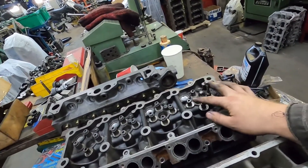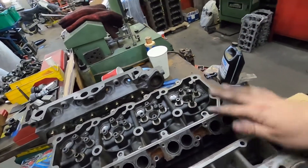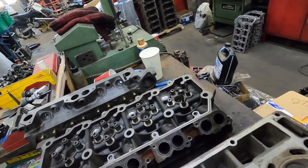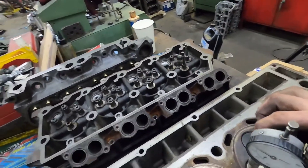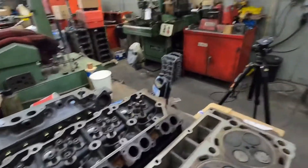That's the reason you put them in spec. A lot of times if I know the engine is going to get a camshaft — say I'm building a 6.0 or 6.4 — I'll put the valves deeper into recession in the head to make sure we don't have that problem, and then bring the installed stem height back to where it's supposed to be, usually on the minimum side.